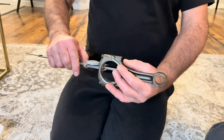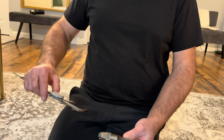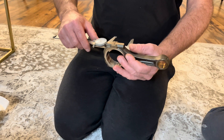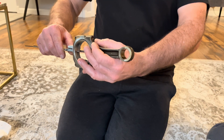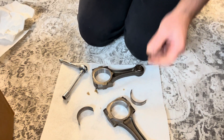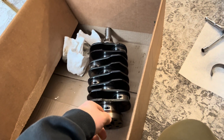68 millimeters — it was two inches 168, this is two inches 174. Five thousandths difference — not good at all. We're gonna junk the rods but maybe salvage the crank.